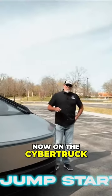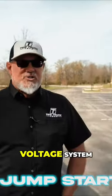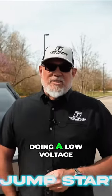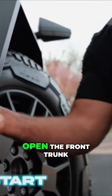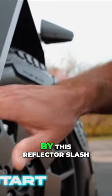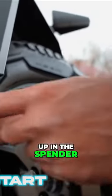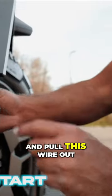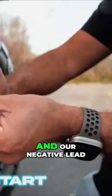On the Cybertruck, there is an oddity here. This is a 48-volt low-voltage system, but when you're doing a low-voltage jumpstart, you can wake it up with a 12-volt box. In typical Tesla fashion, they do have a remote lead to open the front trunk. Right here, by this reflector slash marker light, there's a rubber plug up in the fender. You'll pull the rubber plug out and pull this wire out, and we have our positive and our negative lead.